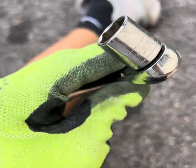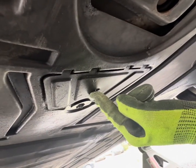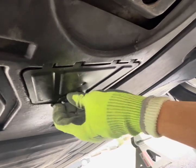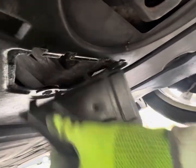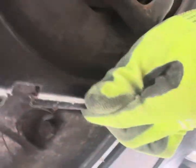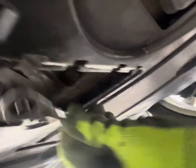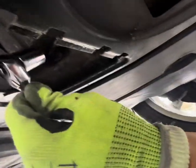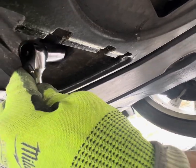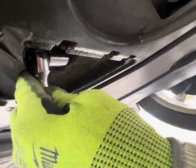Slide the oil pan under. We're gonna be loosening a nut underneath the car using a 17 millimeter socket. You're gonna have a little cover right here — usually it's off because people have already worked on it. I'm just gonna rip it off. Here you're gonna have the 17 millimeter bolt. We're gonna break the bolt loose with the socket and let it drain into the pan. I'm going to put the camera down because I didn't let the car cool down — it's been running for about two hours.